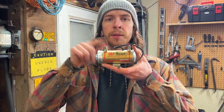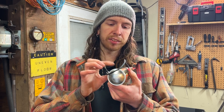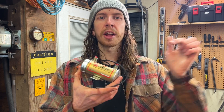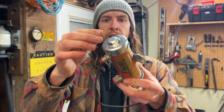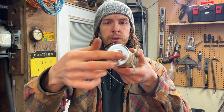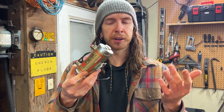This here is the heart of the operation — a Facet 12-volt 36 GPH electronic fuel pump. These are really nice units, made in the US. There's a replaceable filter in that cartridge. This one was new old stock — I found it on Facebook Marketplace.